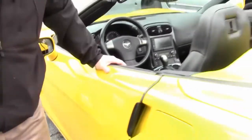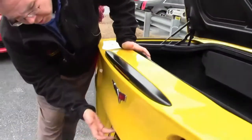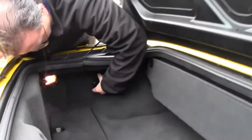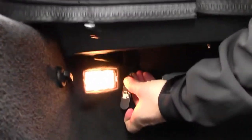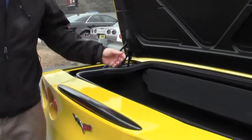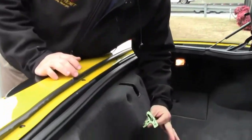As we move to the back of the vehicle, inside the trunk — if you were ever to lose power in your C6 — the only keyhole is right underneath the Corvette logo right in the middle. Then on the inside of both the coupe and the convertible, there are two pulls: one for the door. So if you were to lose power, all you'd have to do is pull this and the driver's side door opens right up. If your fuel door didn't want to work, there's also a fuel door pull, very easily marked. And if somebody got stuck inside a convertible, you can always pop the trunk from the inside as well.